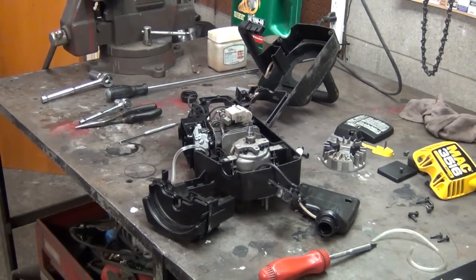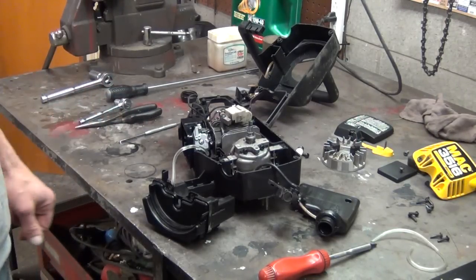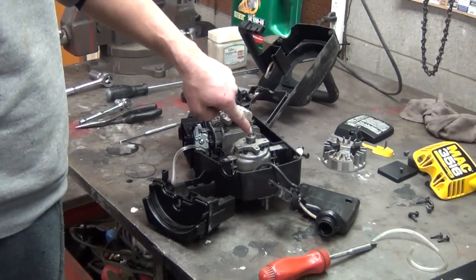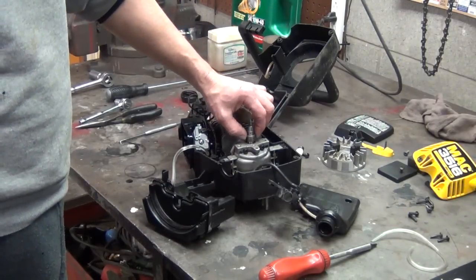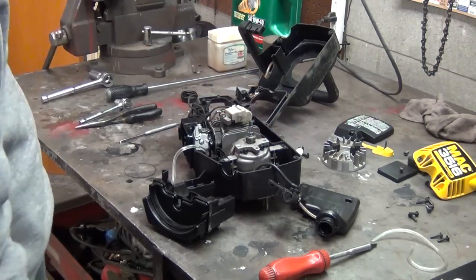And it was all burned up, and I took a little 1/8-inch carbide end mill, which you see me use bigger end mills on my Bridgeport mill. And I used it to deburr the keyway out so I could beat this thing in there. But anyway, that's why I'm not taking the worm gear off, is because I'm not taking that keyway back off.